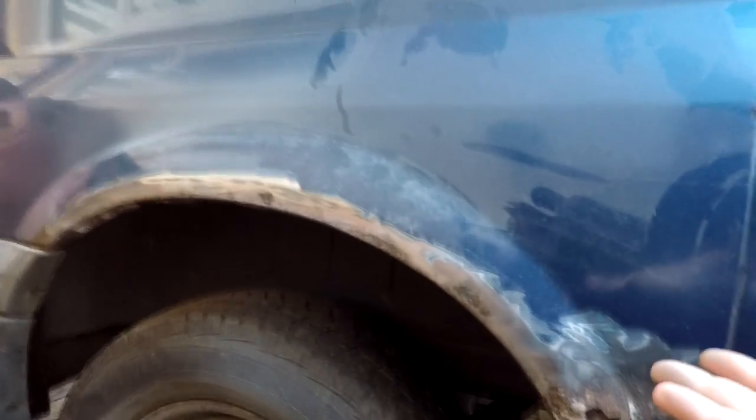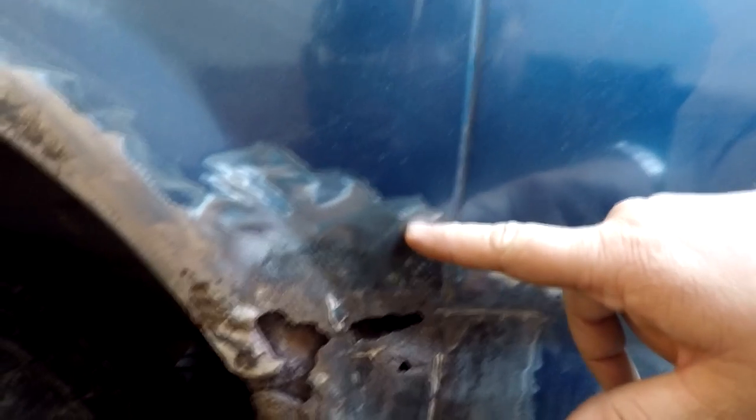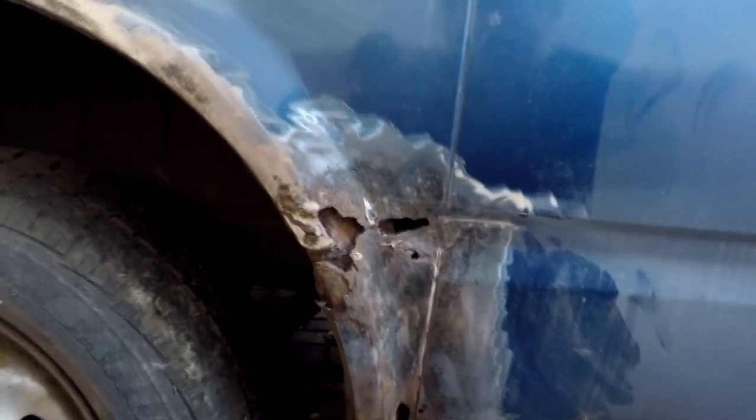As you can probably see around here, there's filler underneath the paint - so this has been painted before. It's had a skim of filler over all this. So people obviously covered up these rust spots before and dressed it up. We're going to be basically doing the same - it lasted for the amount of time it was done. There's bare metal there, that's bright metal, so that's where the main rust ends. I'll be cutting just above there and getting rid of all this surface stuff. I'm going to put you on time lapse, get it all cut out, and then we'll take it from there.